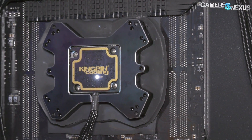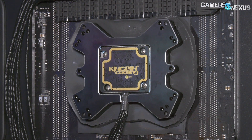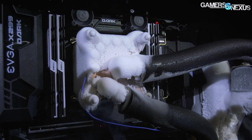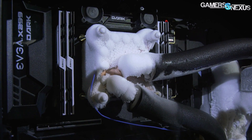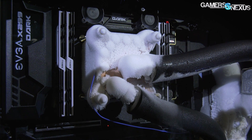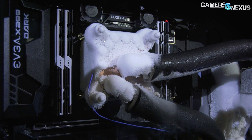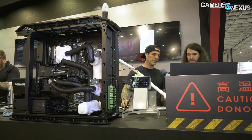We succeeded through this run at 5.6 gigahertz — 20K CPU score. The system can do this no problem. So what's the next objective? Let's try 5.7. The limit of this CPU is a little over 5.7 on the best day, so if this thing can do 5.7 I'd be pretty happy. I set the ring ratio to 37 and all the CPU multipliers to 57, using fixed ratio overclocking.